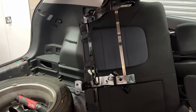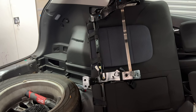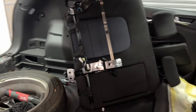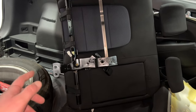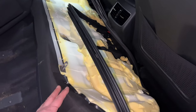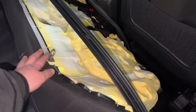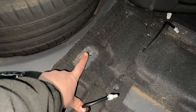Now on to the rear seatbelts. I've done this off camera on the passenger side first, just to familiarise myself with the job as I've not done a Hyundai before. I have a genuine workshop manual from easymanuals.co.uk — I think that was £15 for a PDF straight onto my phone — just to have all the torque specs. To do the rear seatbelts, first thing you need to do is take off the bench seat. This just pulls up — there's a little metal hook either side. Lift up either side, this will pull out, which then exposes a couple of bolts in this area on both sides. And if you go in from the boot, you'll be able to get to the bolts behind the seats.